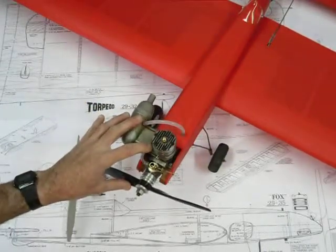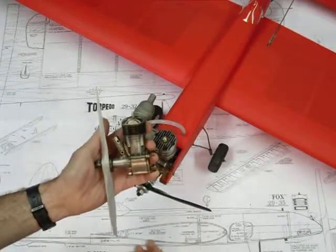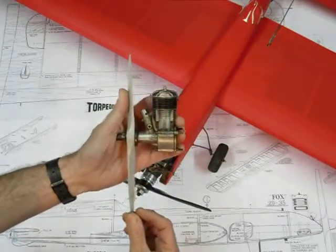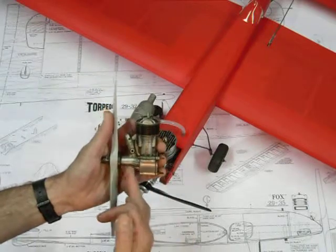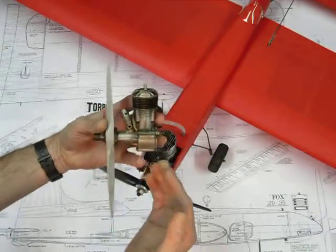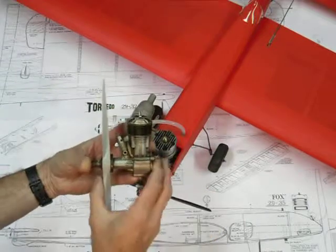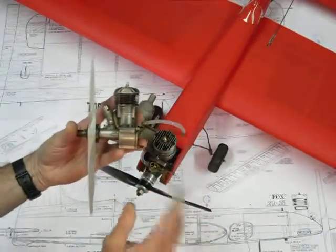In the final video I showed last summer 2014, I had this model engine in the model that was just about to fly its maiden flight. This engine is an original Frog 500 — British design, British made, again from the 1950s. It belonged to my father, who flew Control Line models back in the 50s. The engine is a plain-bearing engine, and I'm pretty certain it was not designed to run on synthetic oils. So I went and got some castor oil and added it into my normal fuel mix, which is 100% synthetic oil.